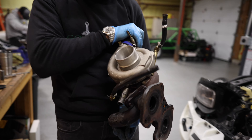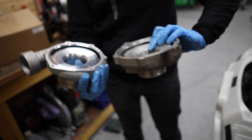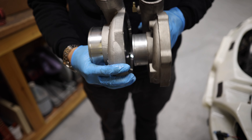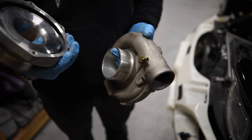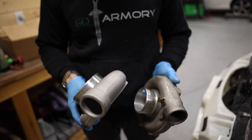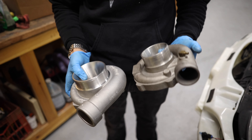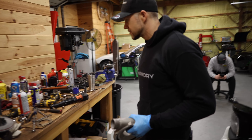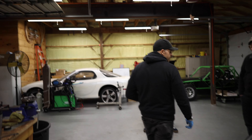There she is — finally! Here's the old 57 trim compressor cover, and here's the TO4S. Quite the difference — just the inlet size is a huge difference. I wonder if it's gonna be an issue — I don't have that vacuum nipple on this one. That goes to the wastegate, right? Or the boost controller — the boost controller interrupts that signal to the wastegate. This thing is going to boost — it's going to be like 21 PSI.